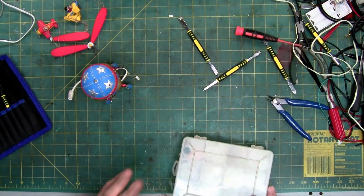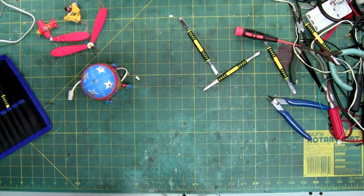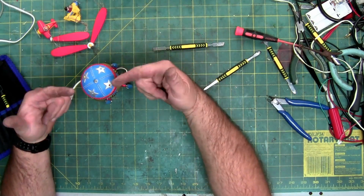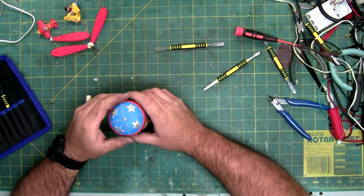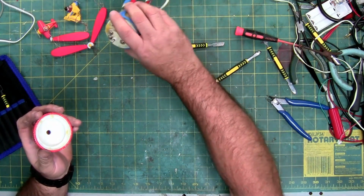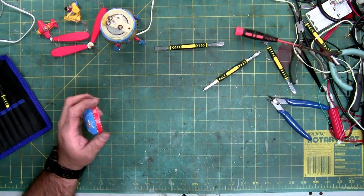So there are choices. You could replace it with a brass bushing or an aluminum bushing or a steel bushing and just cut it down to size. This was white nylon, as you can see, just like the one I pulled out that's a tapered bushing. So you got choices. The point is to make it work and make it as close to factory as possible.